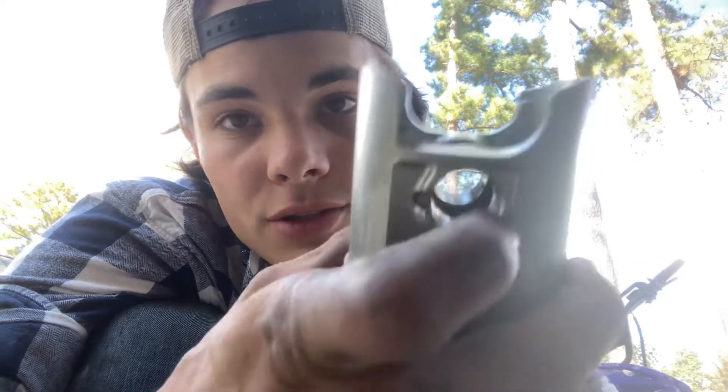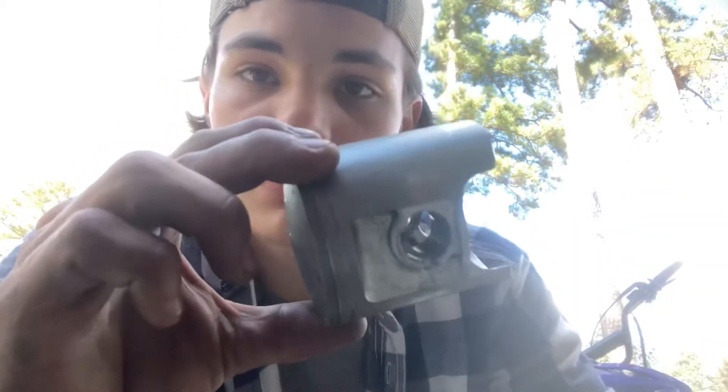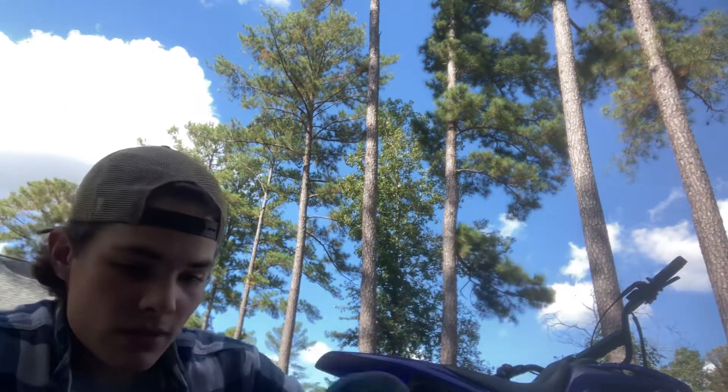Here's my piston. There are no unusual scratches — I can't feel anything on the side — but I do need to take some measurements and see exactly what's going on piston-wise. As of right now, if I measure this and it comes back out of spec, which I think it will, I'm going to need a new sleeve for this.